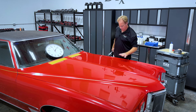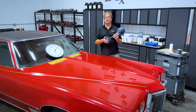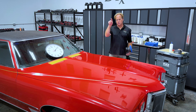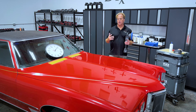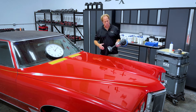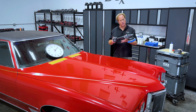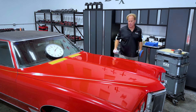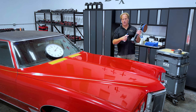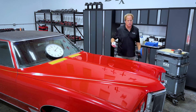I did six different sections. It's about nine minutes in — quick battery test — I still got two bars ready to go. Something I want to point out about a tool like this: there are two actions — the rotating action and the oscillating action. That's a lot for a cordless tool's batteries to maintain. It's going to wear down the battery faster. The same battery in the rotary will go a lot longer. The gear-driven orbital is really going to be your battery hog. So keep that in mind — it comes with two batteries. As long as you're meticulous about switching to the fresh battery as soon as one dies, you should always be buffing without ever being without a charge. If in doubt, just buy a second or third battery.